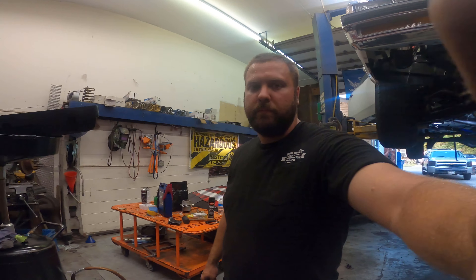We got it all done. It's actually painted with truck bed liner — that's what my buddy wanted, and it's definitely more durable than regular paint. It's all braced, makes it easy to get to the bolts on each side. It's way stronger than probably that factory mount because of the way I built it and the thickness of metal I used. I know some people will say it doesn't look as nice as the tube ones, and if you want to go spend $400 on a thicker one or $200 on a tube one that's fine — I support you 100%. But in this build we're trying to keep it budget friendly.